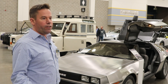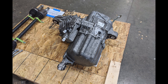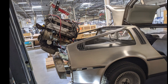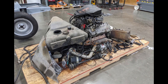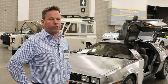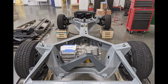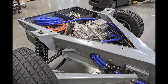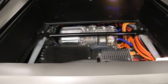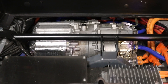It is a Tesla drive unit, probably came out of a salvaged Tesla. You can find them pretty easily on eBay right now, and not very expensive either. The original engine was a gas six-cylinder engine — it was kind of anemic, really slow, especially with the automatic transmission. So we took all that stuff out. Originally I was going to put a large Tesla drive unit in it, which has got a lot more power, but it actually doesn't fit. The chassis is designed by Lotus — it's kind of a double-Y frame — so there's not a lot of space back there. The Tesla drive unit has got the gearbox, which is single speed but there are still gears in it, and the inverter all in one package. You've got the half shafts going to the wheels, so that has to be positioned very specifically. That small Tesla drive unit is the only one that's going to fit.